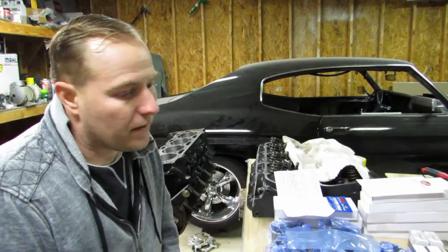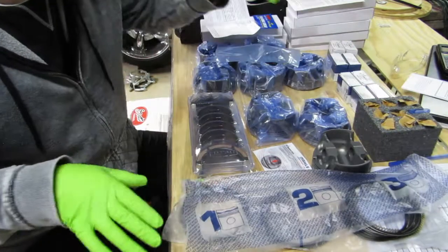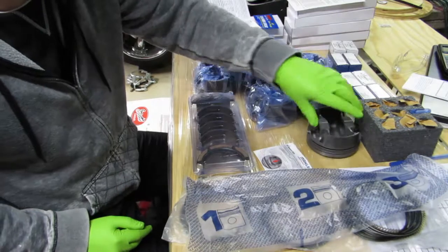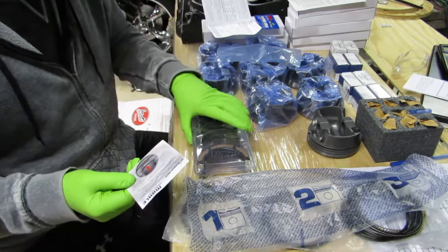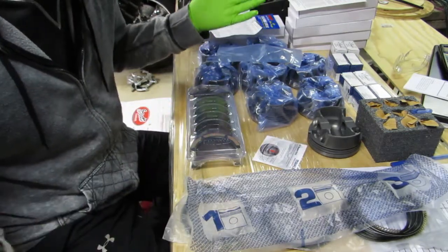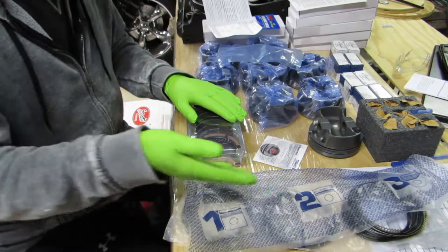I had some debate when cutting these rings. It's pretty easy — one, two, three, can't screw it up. But going from the directions, your second ring is dual-hatted: it's an oil scraper and it also catches some of the compression. What little blow-by gets past your first ring can get caught between your first and second ring.